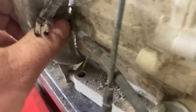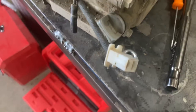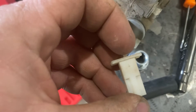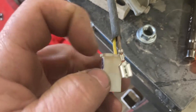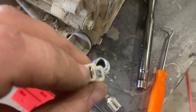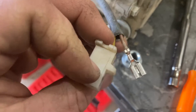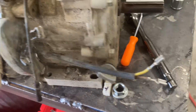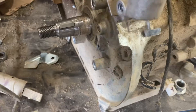We need to get the wires out of the plug so we can feed them through the tin work on the 224. I'm going to take my marker and mark that yellow went on this side of the plug and brown on this side — just for future reference so we can't mistake which way the wiring went. There are special tools to remove these, but I just take a pick, run it down behind the connector, and it detents just enough to pull the wire out the back. With the plug removed, we pull the wires through — there's a little rubber grommet there that we're going to save.